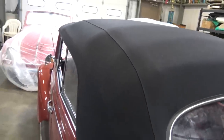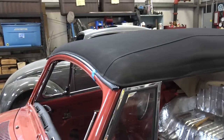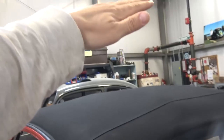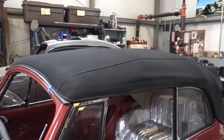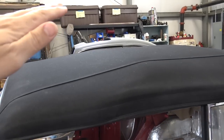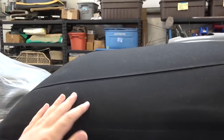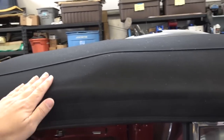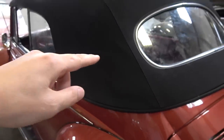Practically wrinkle free — just a couple of spots — but these wrinkles will come out the more it beats out in the sun and the more you mist it. When we first installed it, we could not get this top down or closed for a while; the top sat much higher and would not want to close. But I put it out on a nice hot day, rolled the car out, and was misting it with water while the sun was beating on it. You could see the steam coming off it and the top slowly approaching the windshield frame. Eventually I was able to clasp it down, and I let it beat out even further and misted it more — more and more wrinkles were coming out, giving a more uniform look.